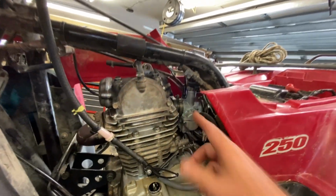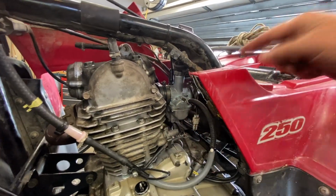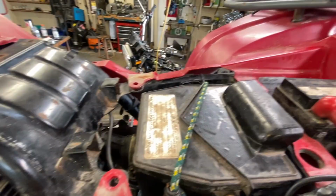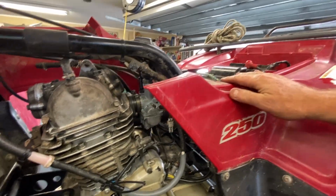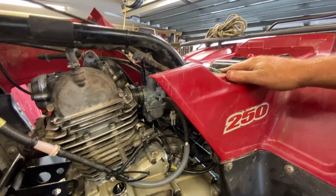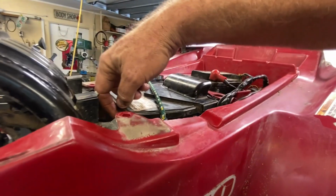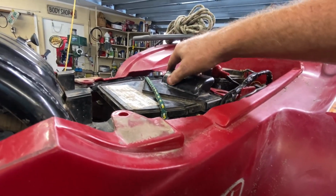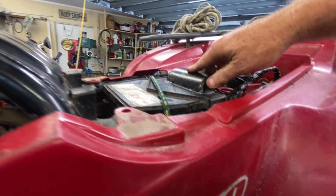Carburetor, yeah. So we're just going to throw the same one in here. It does not fit right. It's not long enough, so the carb intake pipe going from the air box to that is a little bit short. This is just not the correct setup, but again, it is what we're going to have to do. The other problem we have here is this air box cover. I think I mentioned that just now. I can't remember. Keep getting interrupted by somebody.